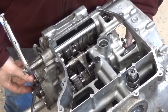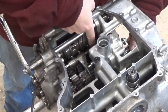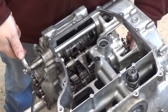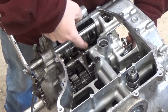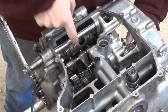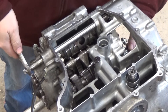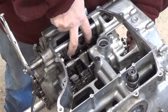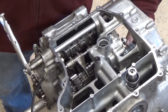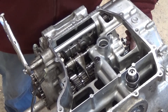That's into third, and now every time I turn the crankshaft the gear is spinning at a faster rate. Going again, this one moves back to the middle position and this fork moves over — that puts us into fourth. For fifth, this fork stays in its path, this fork moves over to the left, and this fork moves to its middle position. For sixth, these two forks stay in their positions and this one scoots over to the side. Now for every one revolution of the crankshaft we've got more than one revolution on the sprocket — greater than a one-to-one ratio.